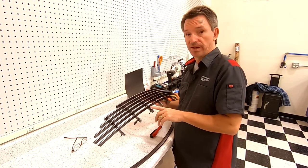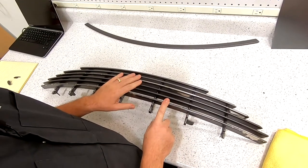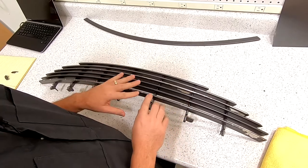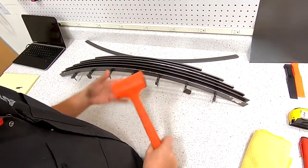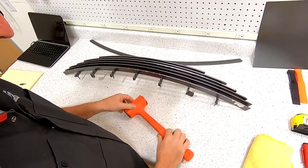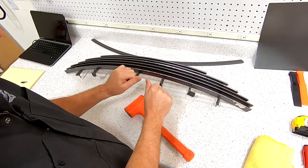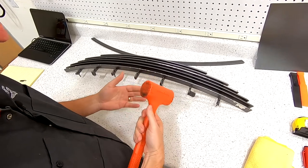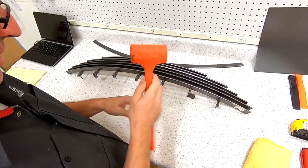So I really don't want to break these plastic uprights while doing this work, and I'm going to show you how to protect those. To disassemble the grill, we need a couple of tools. The first thing I'm going to use is a soft dead blow hammer. I found that as I'm trying to push the bars out, I have a real hard time getting enough force with just my hands, so tapping with a plastic dead blow hammer made life a lot easier.